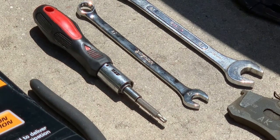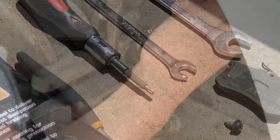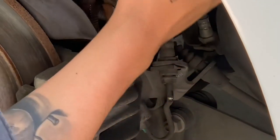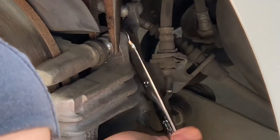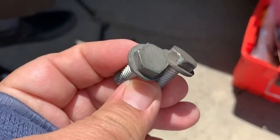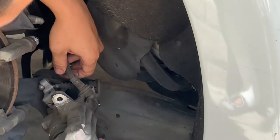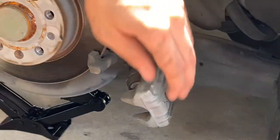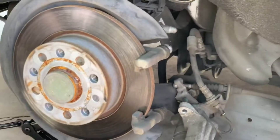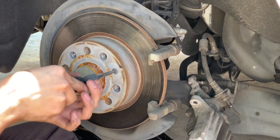To take the rotor off, the screw on the rotor requires a T30. He's doing the top bolt and you gotta do the same for the bottom one. Take off the two bolts from the back of the caliper, then take the caliper off and set it aside. To take the rotor off, take that screw off right there.